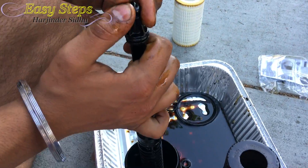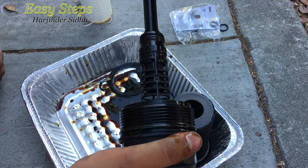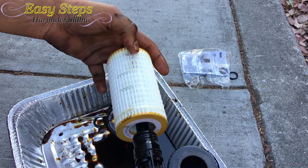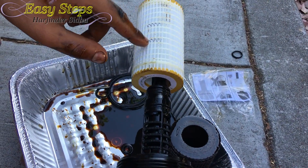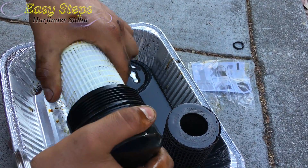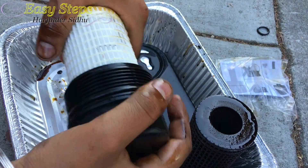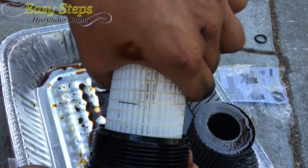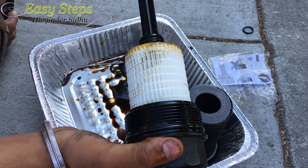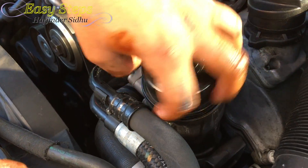This is my last O-ring and my O-rings are on. Here's my new oil filter — there are these two black lines on my oil filter, so you're going to wiggle it on to make sure you can't see the top line, just as I have it. You just want to push it all the way in, insert it back in my car, and screw it back in.